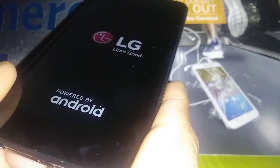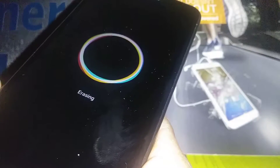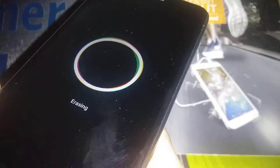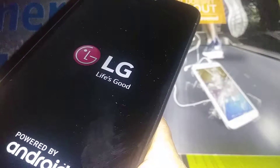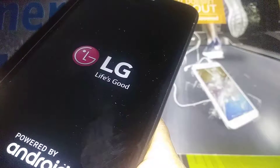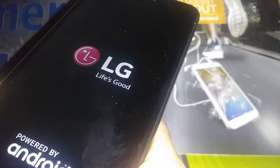This is going to take about five to eight minutes. In case you get stuck on the LG logo for more than eight minutes, or the Boost Mobile logo, or the Android package screen, just long press the Power key for at least five to ten seconds until the screen goes off.